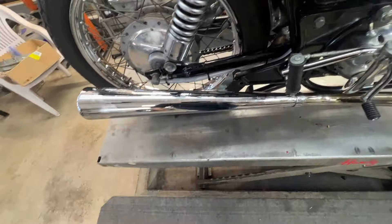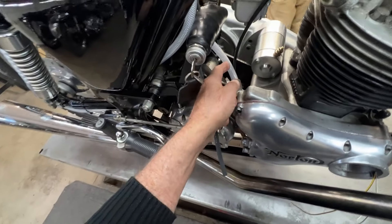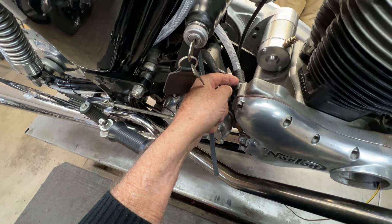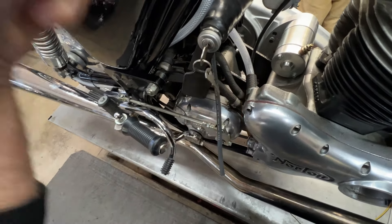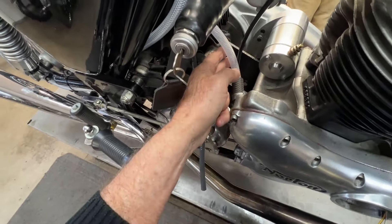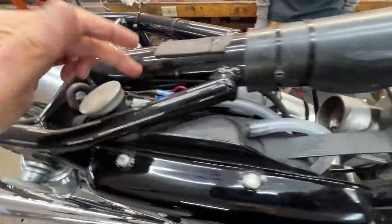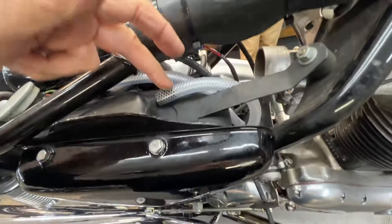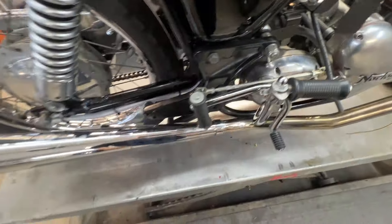Personal idiosyncrasy — do not fret about the size of these tubes. The inside diameter of this tube is the same as the inside diameter of this fitting. Inside to inside, same size — outside diameter doesn't matter. You don't need to put this big honker all the way up to the top because the inside diameter of the big honker is the same as the inside diameter of the smaller tube. I just use the old piece as a little adapter, put this tubing into it, run it up to the vent directly without the adapter that Norton used — and it works just fine.